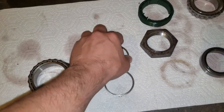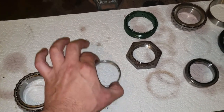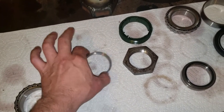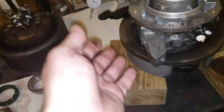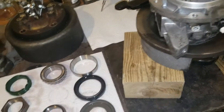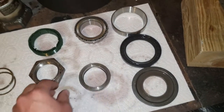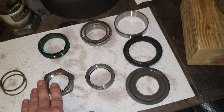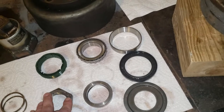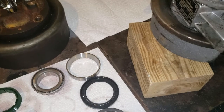After the speedometer gear is on, get your spacers on. I talked about how to get the spacing just right and do your indicator measurements — that's all completely accurate. Then tap your race in, tap your bearing on top of the race, then this goes on top of that — seal side goes down over the shaft — then your nut goes on. Torque that to 215 foot-pounds. You can check your end play again if you want.